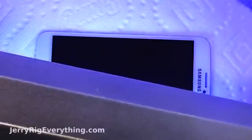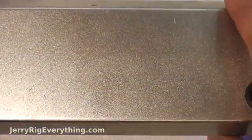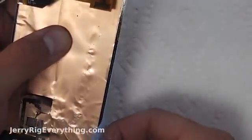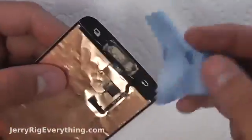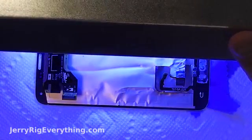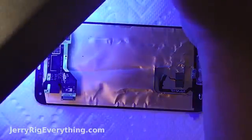Here's the UV light — I'll link this in the video description below; you can use it for any type of repair in the future. The UV glue is a really great way to replace the glass on your screen and it's not even very expensive. I'm going to brush it over the top really quick to get it tacky underneath — the whole process only takes about a minute or two for the glue to completely cure. I'm just going to rest the light on top of the phone and let it sit. Now that that's done, I'm going to take a little rag and wipe away the excess glue along the edge of the phone and around the button, then go over with the UV light one more time to cure any glue that seeped out from around the edges.